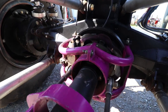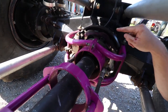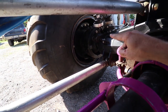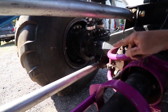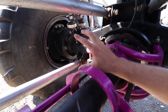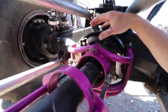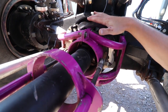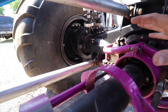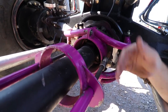Sorry, this is a little bit shadowy out here. A lot of people ask why do we run the brakes on the drive lines. Right here is the drive shaft, here is the brake rotor and brake caliper. We do not run the brakes on the wheels where a normal brake rotor and caliper are because the tires and wheels are so heavy you'd need a gigantic rotor and giant caliper. By having the braking system on the drive line it's a lot more efficient - we use the planetary to help slow it down, so the planetary helps make torque and also helps slow down the truck.